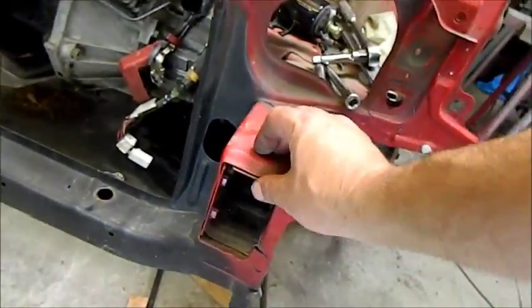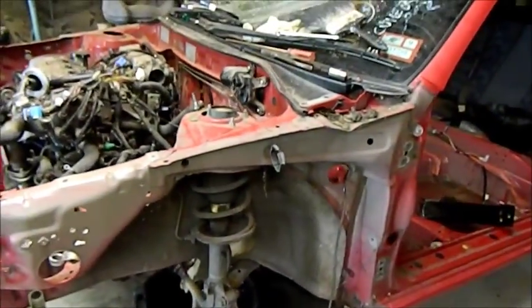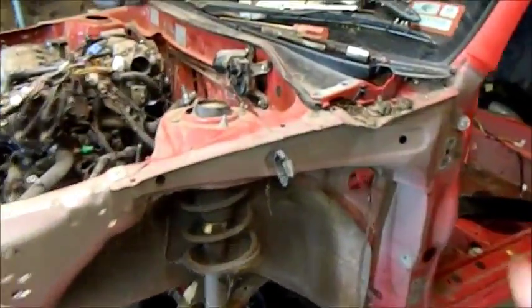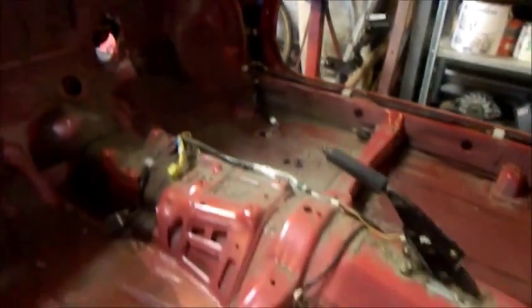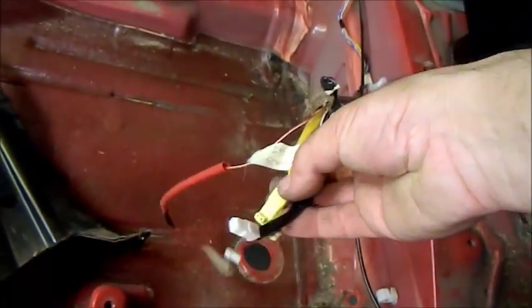And don't forget, it's not to do with the thickness of the metal, it's also the shape of it, how it's constructed. Now, these cars are very flimsy in terms of panel thickness, but the substructure seems really, really good. They're all boxed up around here and down here, obviously in the A-pillar. And even the side, where they have these great big braces installed in them, and there's of course another bar that goes right across the top, which I've taken out and it's sitting over there vertically. I'm going to take everything out of this car, all the wiring, and there's of course the SRS for the safety for the seatbelts. So we're going very, very quickly with it really.